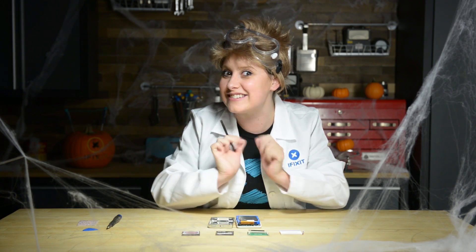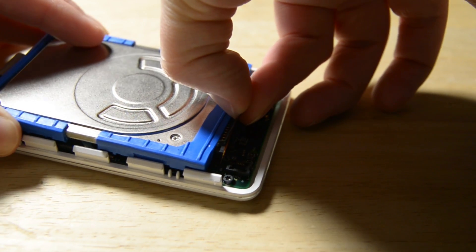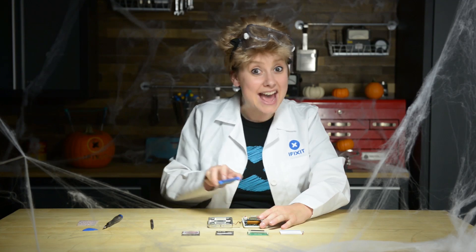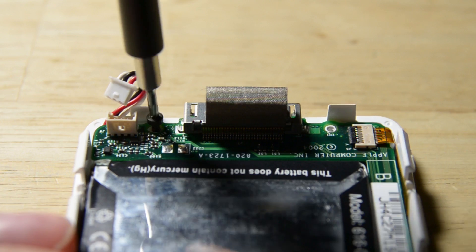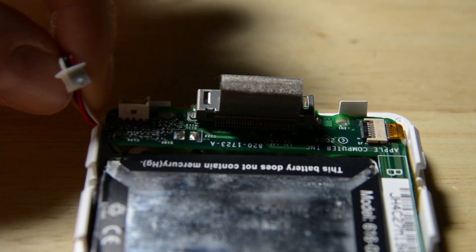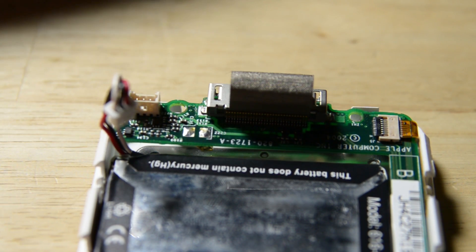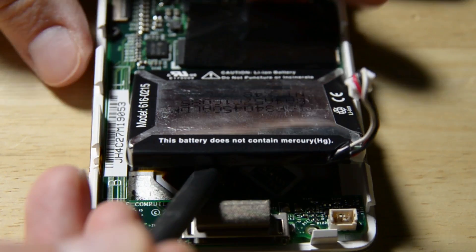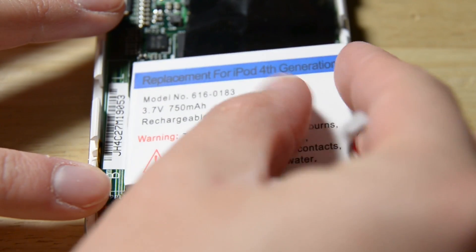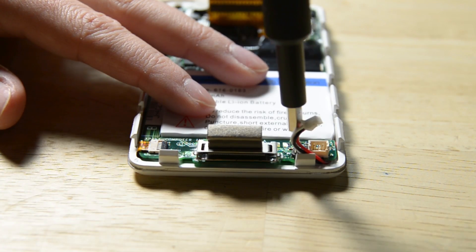Now to remove the brain. Grasp the hard drive with one hand and carefully disconnect the orange ribbon cable from the hard drive using your other hand. Now onto the heart. Remove the two black T6 Torx screws from the left side of the logic board. Carefully thread the battery cable around the end of the logic board — be careful not to pull up on the logic board too much while freeing the battery cable. To remove the heart, we need to release it from the adhesive holding it in place. Use gentle prying with your spudger, but if it won't budge, hit it with a little heat from your heat gun. Once you have the battery out, go ahead and put the new one in, reroute the cable underneath the logic board, and screw the logic board back down.